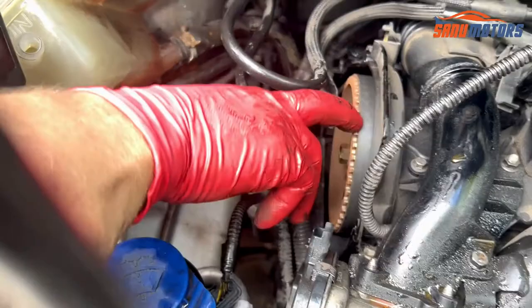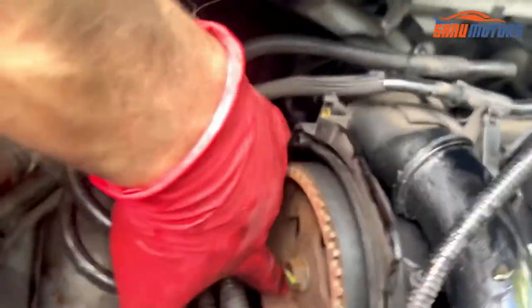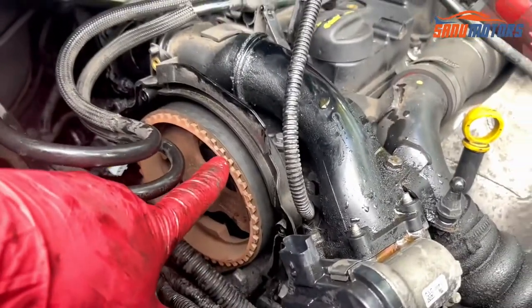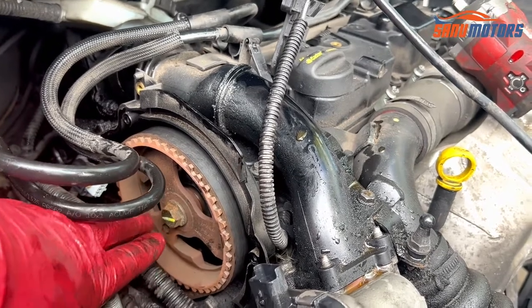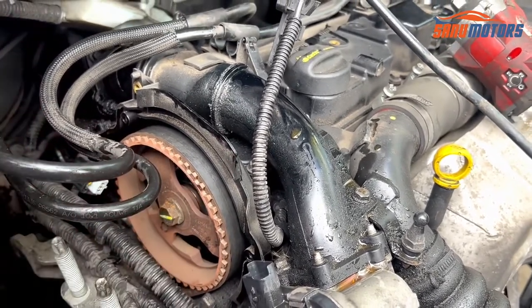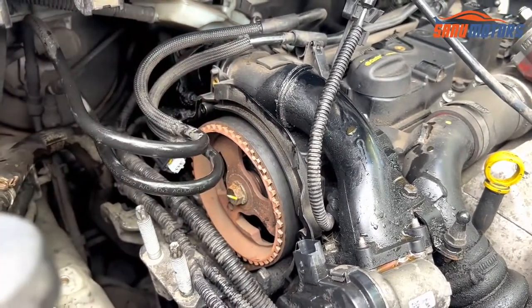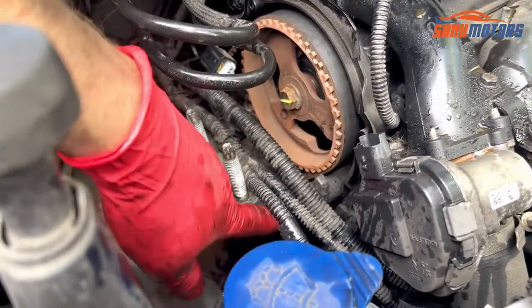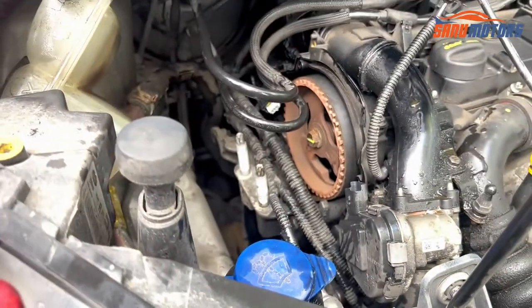That's come out — good. The sensor can be unplugged. I found it's easier to just use a little screwdriver — it's meant to push from behind but I can see the yellow tab, put a little screwdriver underneath it, lift it a bit and it just pops off. Much quicker and easier. Seven mil — we've got four self-tapping sort of screws in there. You don't need to take them right out, they stay with the cover, and you just wiggle it out.